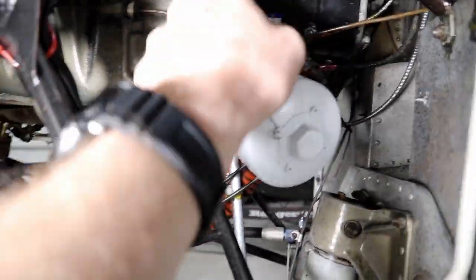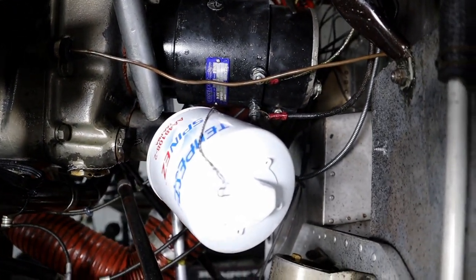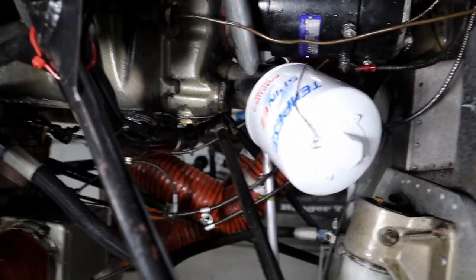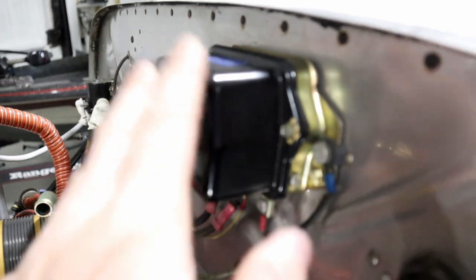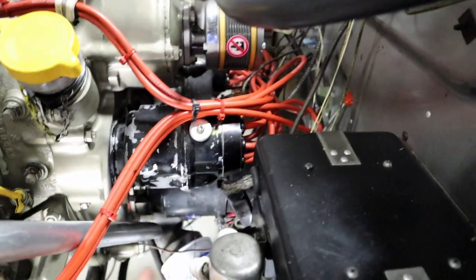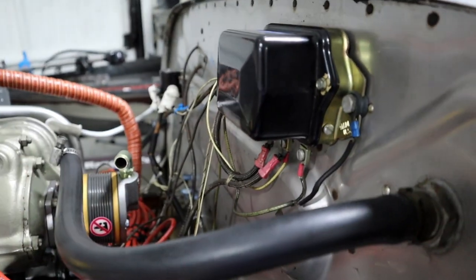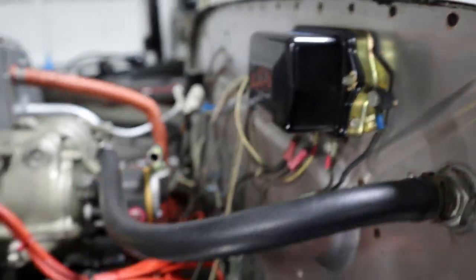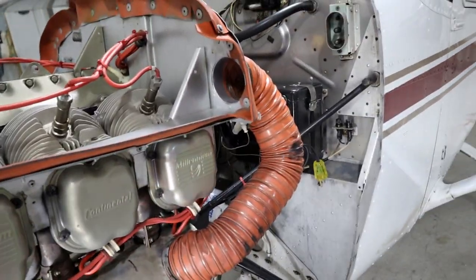Right here is our generator. It's also tied to the back of the engine, so when the engine is turning our generator is turning. And here is our oil filter — it just circulates oil through the filter and back through the rest of the engine. This right here is a regulator. All it does is tell the generator: if power is a little low, produce more; if there's plenty, back it off. That's what the regulator does.